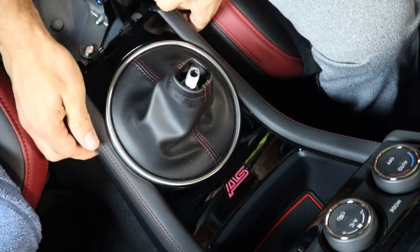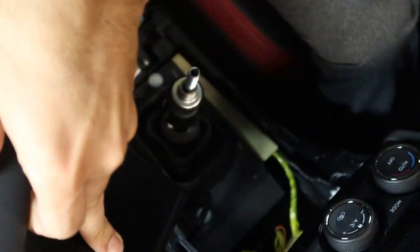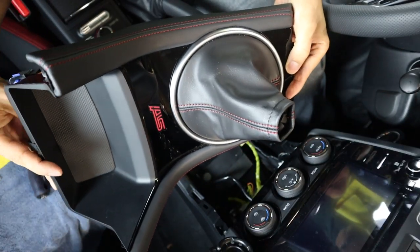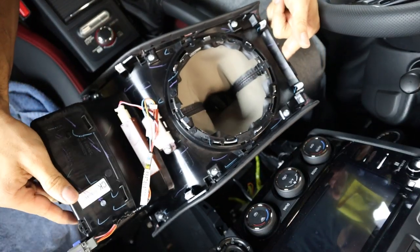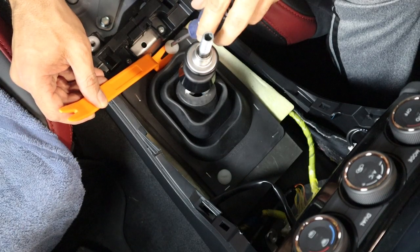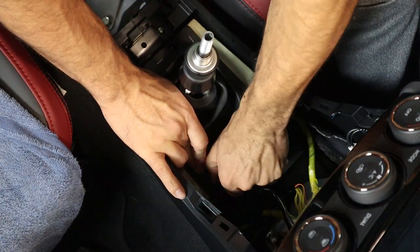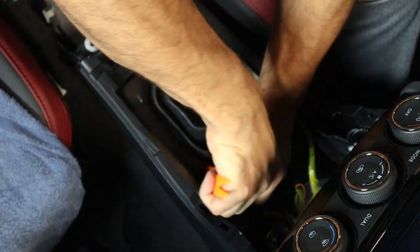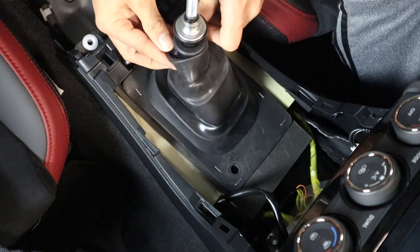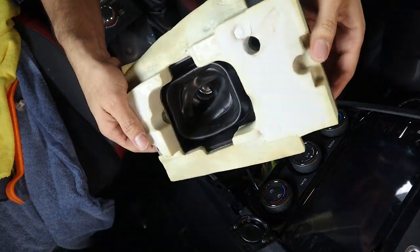With it out of the way, we can snap the shift bezel out carefully. Now remember that the STI logo is lit, so just tilt it to the side so you can unplug the logo's connector — here's a better look at it in case you have an installation in the future that requires its removal. Moving on, what we have here is the shift insulator boot and this helps keep heat and noise outside of the cabin. These two white clips are responsible for holding it in place and usually you can just pull them up by hand or maybe with a simple panel removal tool. Once those two are out, work the boot around the shifter, lift it up, and set it aside.